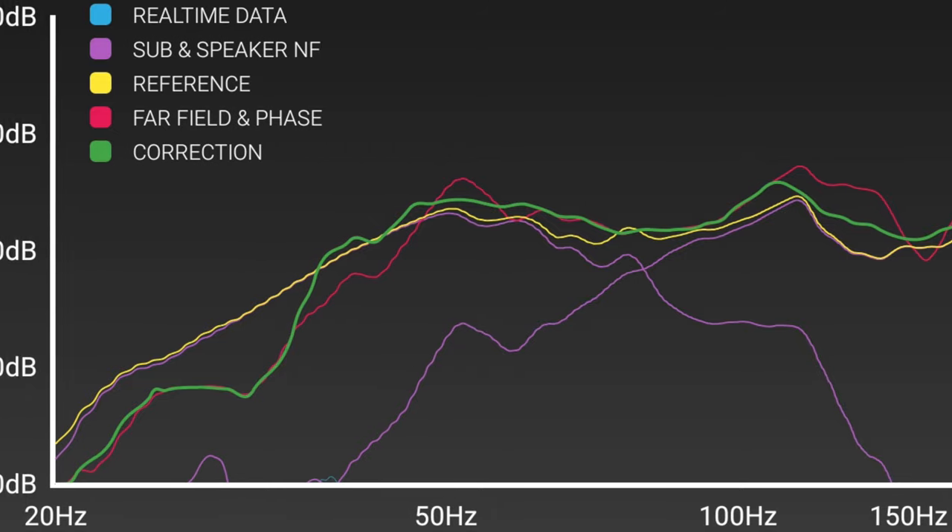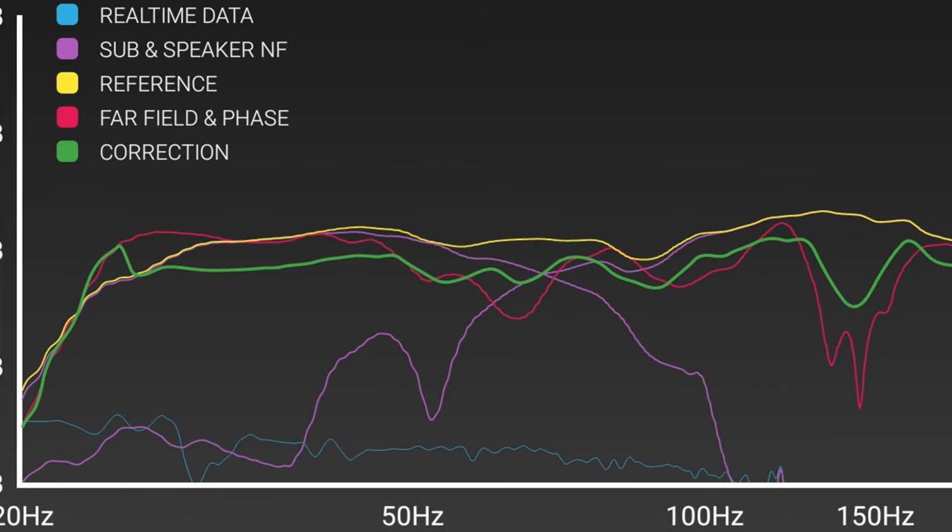One of the biggest problems with integrating a subwoofer in a two-channel system is how do you do it? As a speaker designer, I'm the one who normally integrates bass to mid-range to tweeter, but with subwoofer-satellite combinations it's up to you. So we built in an algorithm to do that automatically. You measure close to the speaker, you measure close to the subwoofer, take those two responses, and it integrates them together and finds the optimum blending. Then you move out into the listening position and it runs a phase adjustment, because the subwoofer might actually be further away from you than the main speaker is. So it corrects for that phase, then runs a room EQ. All of that is built into this two-channel amplifier.